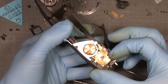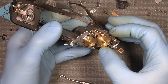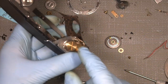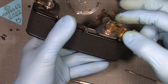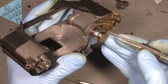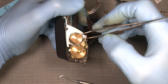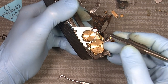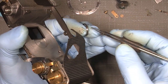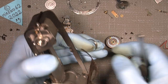I would like to take off the advance mechanism, and since I have some good marks here I know the exact position before taking it apart. So I can unhook this spring and it will go all the way one turn to the other side, then I can take it off. I'll add some color here to make reassembly easier — you can see there is a lower spring end and an upper spring end, just so we know that.